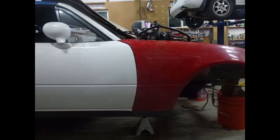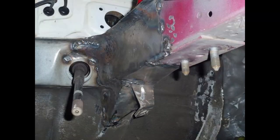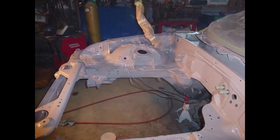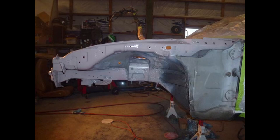Then testing the fender placement — I had a pretty good line on the gap. Here's finishing up the welding. This picture shows the driver's side frame rail with the stiffening unit, or fish plate, that I welded on. Now I'm on to painting in the engine compartment. This is the primer with everything all cleaned up. As you can see the frame rails are nice and straight now.